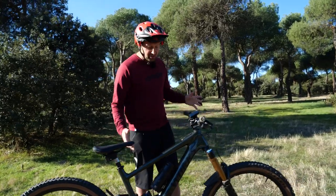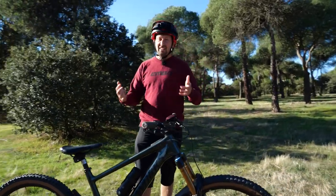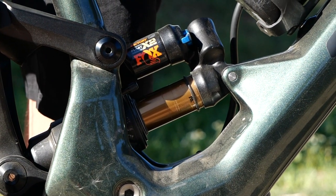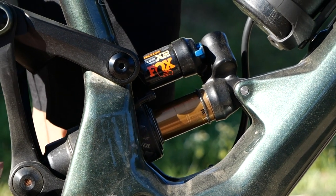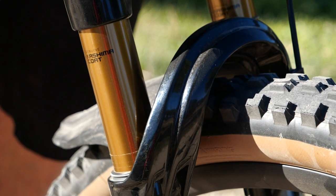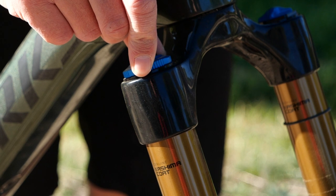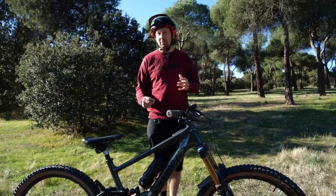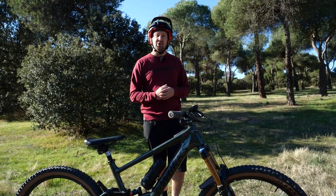Moving on to the suspension on your bike. If you're riding a hardtail, these are great for trials. But if you're riding a full suspension bike, you need to set that suspension up a little bit stiffer. You don't want that bike diving around all over the place. You want the energy you're putting into the bike to actually make the bike move for you, not sink into your suspension. So just pump it up a little bit harder, add a little bit more preload on it.